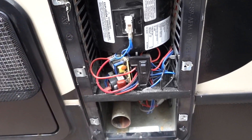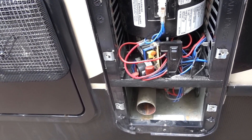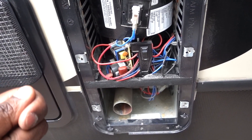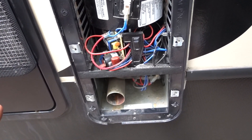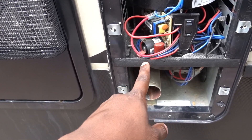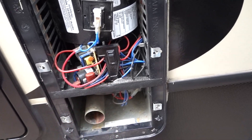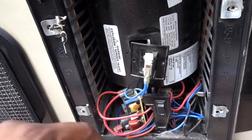Since we've been living in it, it's been smooth sailing. I always recommend, if you plan on doing winter camping or live in a climate that gets cold, it's probably a good idea to keep one of these on deck. Depending on what brand you have — I have a Dometic furnace which I don't really like — I hope my next RV has a Suburban. The control board had water damage at one point, but they did some upgrades and it hasn't had that problem since. I'd recommend having a sail switch on board.